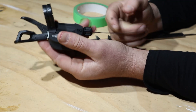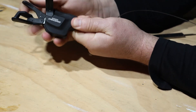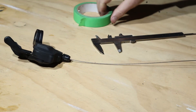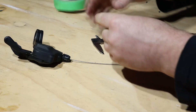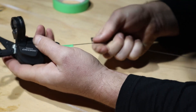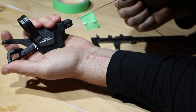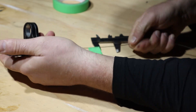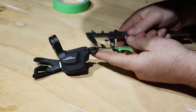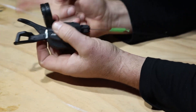So how we work out the distance that one shift moves: I've got the cable in it and I'm gonna shift all the way up to the top. I then take a little piece of tape and put it right up against the top, shift back down, and you should see that cable start to come out. Once I'm at the bottom, I can use my calipers and measure that distance — 32.5mm — and then I'm gonna repeat this with the other shifter.